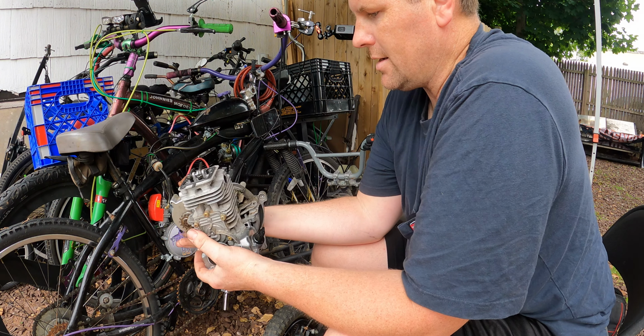So, what we were at, this is Lynette's motor for her nephew, I think we'll say. I think it's a nephew, whatever. A young fellow that she knows she's given as a gift, I think, for graduating or something like that. Didn't get into the particulars, just wanted to know what you wanted done. So, this is what we got done, and then I'll actually show you on the motor itself. So, our stock numbers are 124 intake, 104 transfers, 142 exhaust, and 19 degrees blowdown.